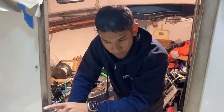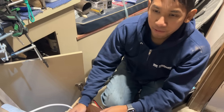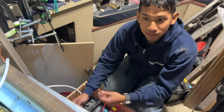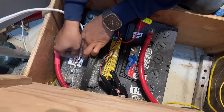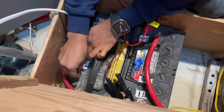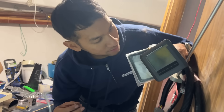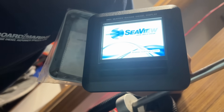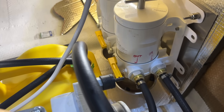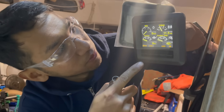The time has come. We are going to hook up all the electronics on the boat — if it blows up, I want it on camera. This Cummins engine has a little ECU doohickey that needs constant 12-volt power. Now I've got to wire up some of the additional engine stuff. Fortunately, for this marinized version of this engine, a lot of things are really plug and play — thanks to Seaboard Marine. They've designed a whole bunch of controls for my motor. The engine is trying to prime itself right now — the lift pump is lifting the diesel from the fuel tanks to the fuel filter to the motor. I think all we have to do is hit start.